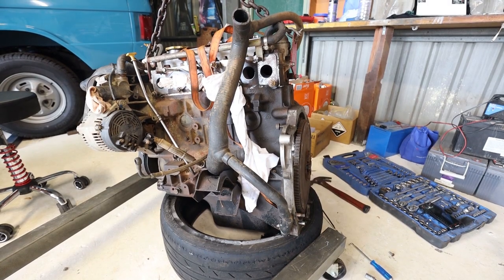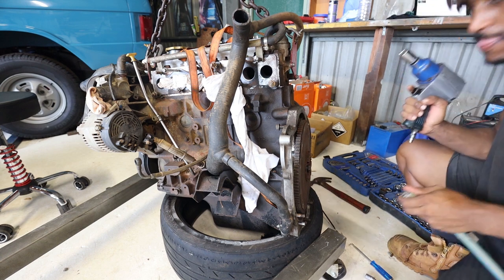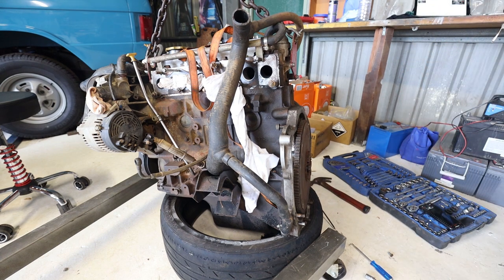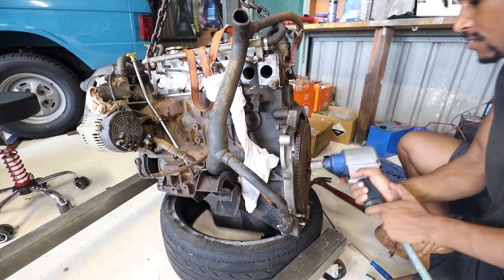With the engine in the shed, the long and arduous process of removing, cleaning, and replacing all the worn out items had begun. First on the list was removing the automatic flex or flywheel plate and getting the engine ready to be mounted on the engine stand.